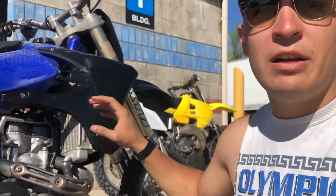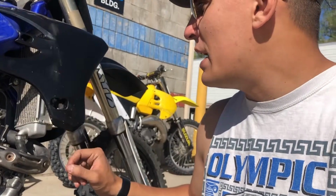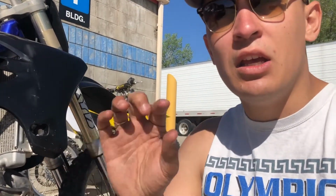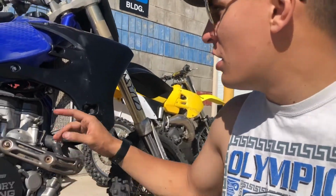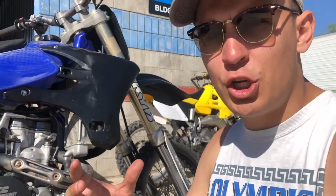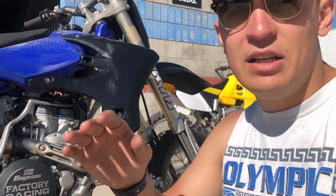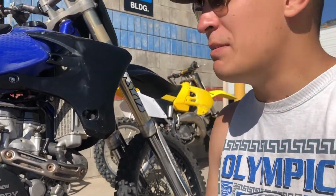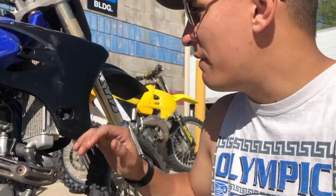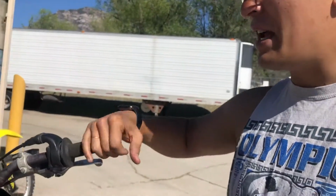running, and then it started making this horrible noise in the top end. So then we took it all back apart, realized that it was missing a chain tensioner, up on top. Not really the tensioner, you know, tensioners coming in from the side, that was working great, but there is a guide, like a hard plastic slider up on top that it was missing. So it was rubbing against the valve cover up there. We had a sticky throttle for the longest time, but it pops right back now, as you can see.